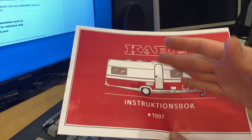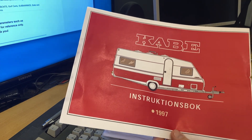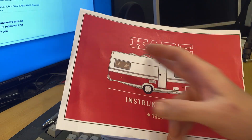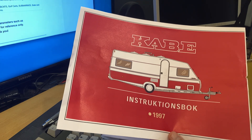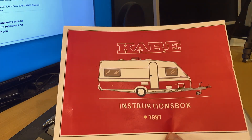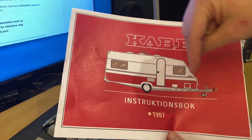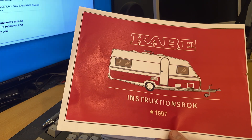The heater is fine to run on gas because it's pretty damn efficient - it burns gas, heats water, and circulates the water around. This uses extremely little electric power. You could probably run it off the 12-volt battery. The only things running off the 12-volt battery are the lights inside and the heating system. The fuse for the heating system is just one amp. It needs a little ignition spark and then a small circulation pump in the expansion tank - that's enough to circulate the warm water. And it also has hot water, which is extremely luxurious.